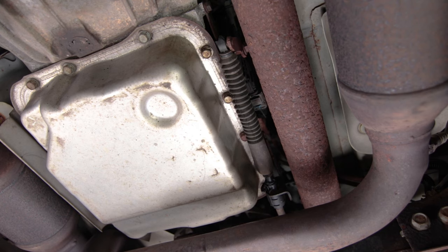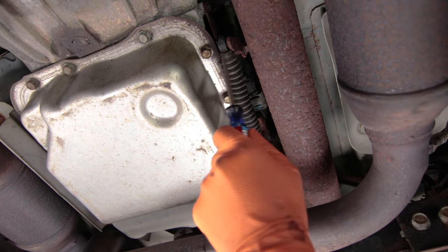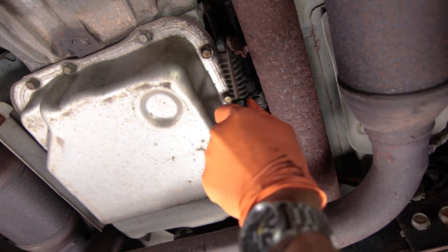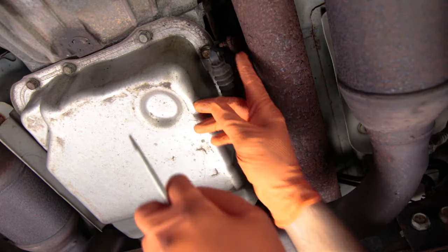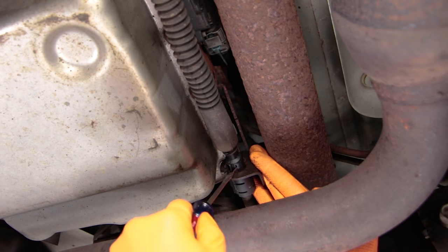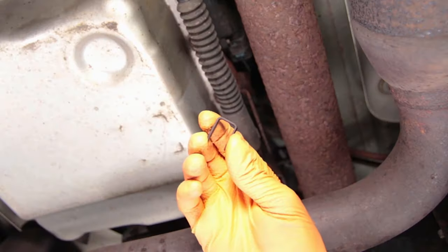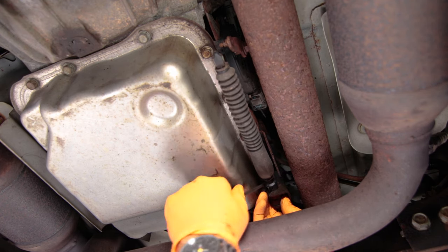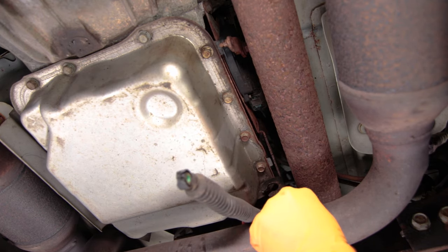You don't always need to replace the 3-2 and the torque converter ones unless you're having issues, but we wanted to show you how to do it anyway. So we're under the truck right now — the camera is facing the back of the truck and the shift linkage is on the driver's side. We need to remove or at least disconnect it to drop the pan. Just pry this out with a screwdriver, wiggle it out, then pop this clip out holding the shift linkage into the bracket — it just slides out. This clip kind of looks like a staple. Push in on the tabs on each side to pull it out. Once it's out of the way, the bracket will bend out a little with a pry bar.